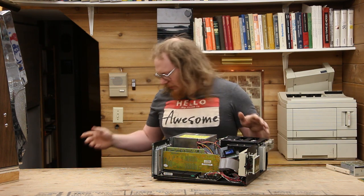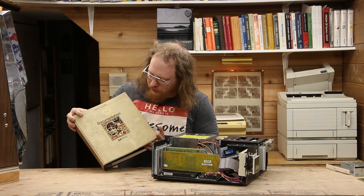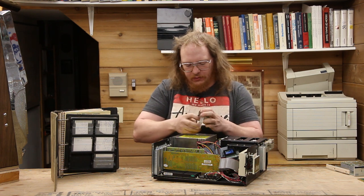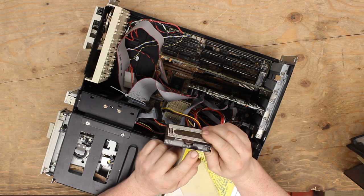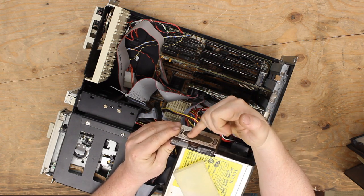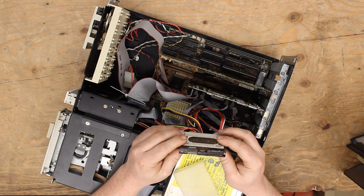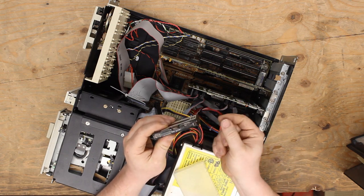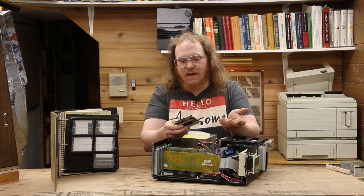The tapes themselves aren't a whole lot better. I have a tome here for my HP 9845 — at this point it's so moldy and nasty I can't really use it. It contains some very early examples of this QIC tape format. The problem with these is it's not the roller that's gone bad — that's hard plastic — but the rubber band inside the tape, which is used to move everything around, has bonded with the tape inside. So when you move the roller, it'll actually peel the oxide right off the mylar backing. As a result, the data on the tape is rendered unreadable.